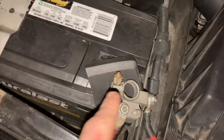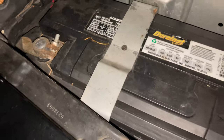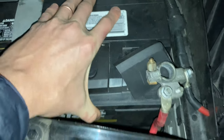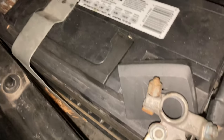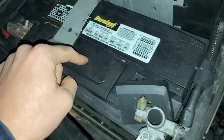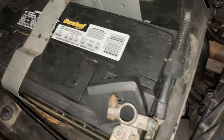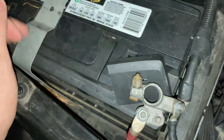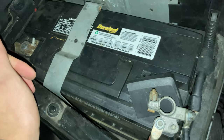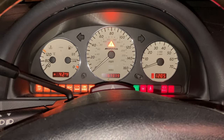Battery is unplugged - I did the positive side even though you should do the negative, it's just a little hard to get to. I noticed the battery is able to shake around a bit, which is not great. I think what I might try to do is switch this out - I have an Odyssey battery I need to swap in anyway from the C55. Maybe it's time to get this thing out and inspect the whole area, inspect the ground wires, and make sure it's anchored down properly. Let's plug it back up and see if it's worked some magic. This sucks.